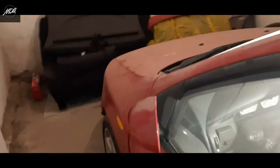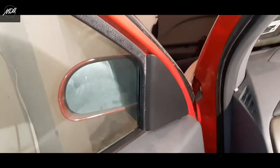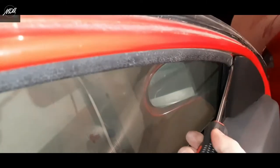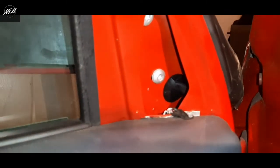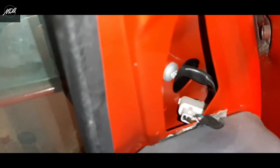As a next step I would like to continue with the side mirrors. To remove them I believe I should go inside and remove this plastic cover. Let me try it with one hand. No, it's not going to be that easy. Success! So after removing the plastic cover we have just two bolts - or whatever you call this - and one clip.